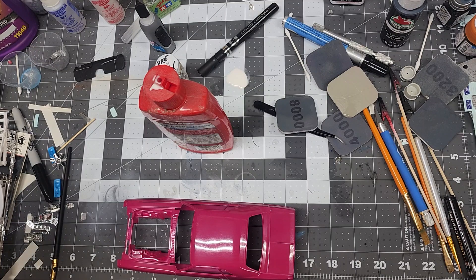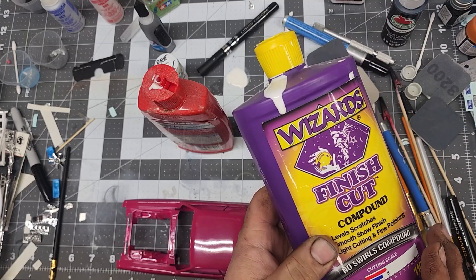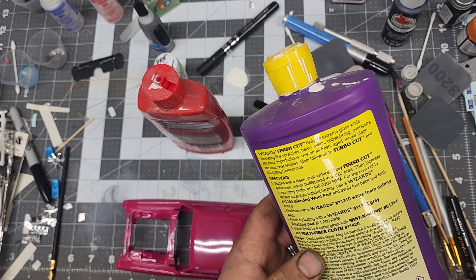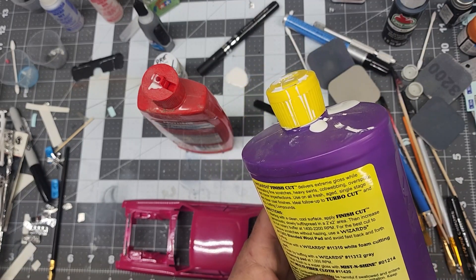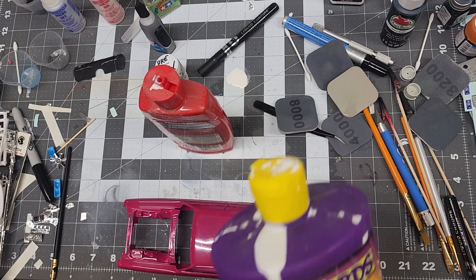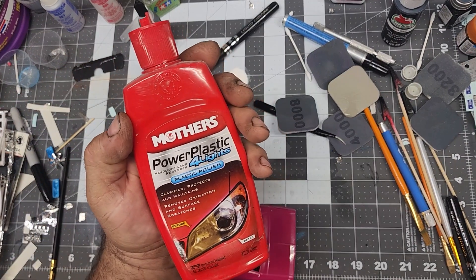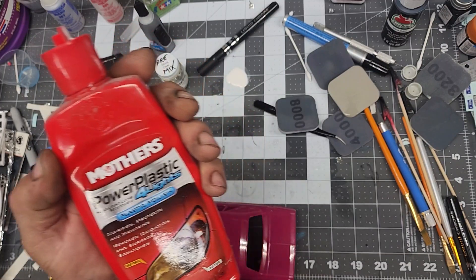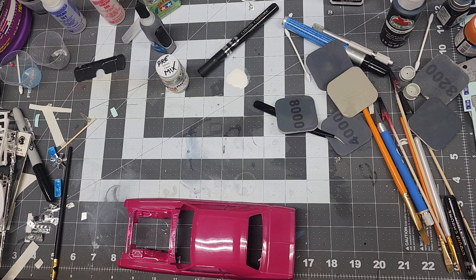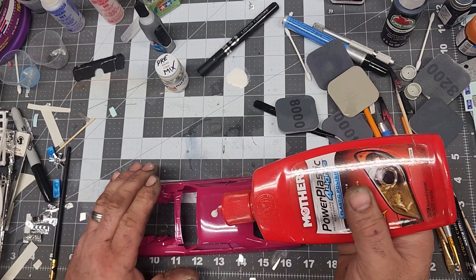I did a little experimenting with what I have at the house. I started with the Wizard Final Cut — it's a medium cut, good after wet sanding an overall paint job, but it's more of a beginning cut. They recommend following up with the Turbo Cut which is a slightly smoother polish. I think the Final Cut was just a little too aggressive. Then I remembered I had some Mother's headlight restore polish — a brand new bottle — and this stuff actually works really well.